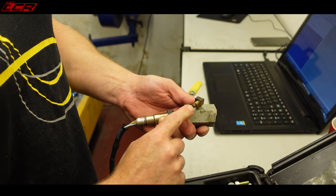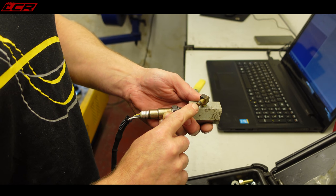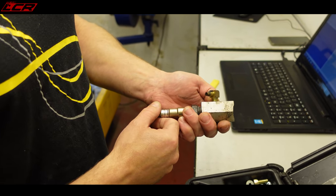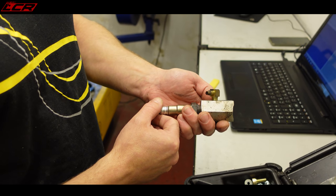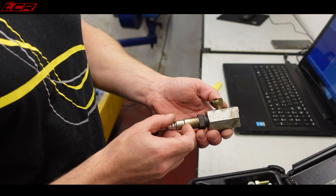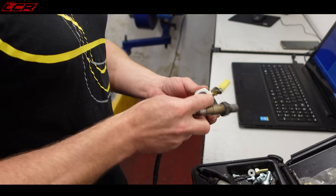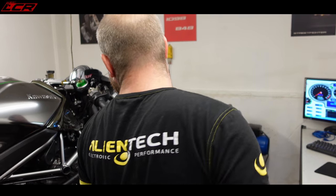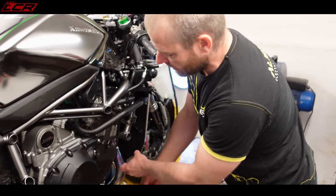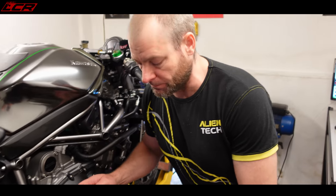And then we've got a pressure air system that draws off the gas, draws the gas over the tip of the lambda. We have tested these before. When these came out in 2009, we back-to-back tested this one in the header and this one a little bit further down, and the readings were absolutely identical. If they weren't identical, we wouldn't do it.